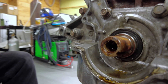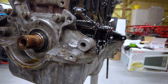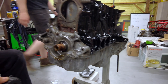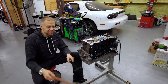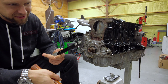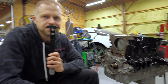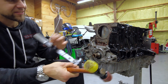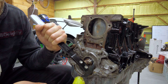How's this seal looking? Looks great. This looks new. It looks like the seal's okay too — it probably would have been fine if we didn't touch it. Now that I think about it, I think I actually replaced all this. We have a rampage of destruction here. I'm going to use my old Craftsman seal puller — it's made in the US. I'm going to use the skinnier, pointier side. You've got to be careful not to score the inner of the crank or any surface you're pulling a seal from.